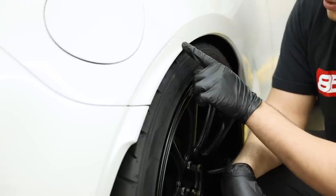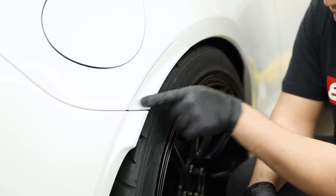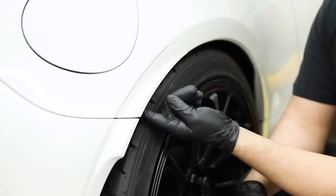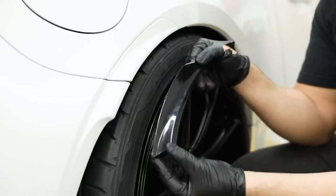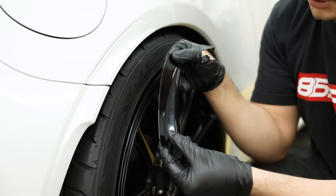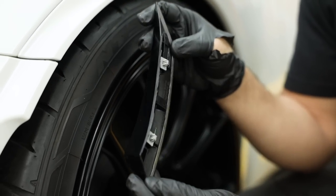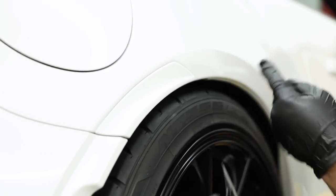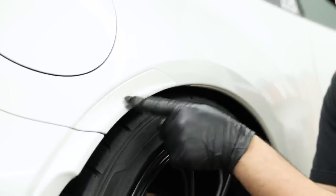In the rear of the car there's this rear bumper tab that people in the community are talking about as a rubbing point. Underneath that tab is a very solid piece of metal where two body panels are pressed together. Here's a rear tab from our black car — that car runs an 18 by nine and a half setup — and on the back side you can see it's rubbing really badly: almost eaten all the way through, beveled out the edge, severe rubbing marks. That means it's also coming into contact with the metal tab underneath. We're going to pry it off and show what people are cutting to fit larger wheels.